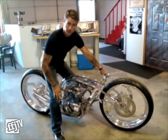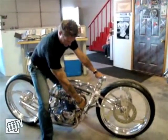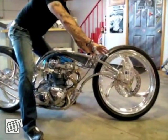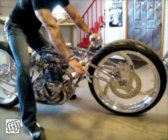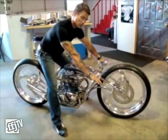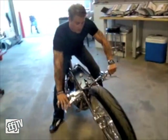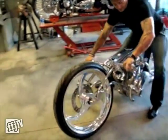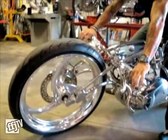We just got done riding — it's a little warm. I want to show everybody: our 75 degrees of rake comes from the two pivot points in the front and in the back, which gives us our full articulating motion. That gives us 30 degrees of turn each way. So at a slow speed, it handles much like a chopper but without the flop — same kind of turning radius — but at your normal riding speed, it's a very comfortable ride. It's a great deal of turning motion; it's fully articulating in both directions. You can see that articulated motion again from this side as I come back around.